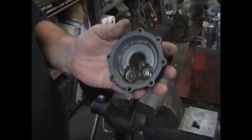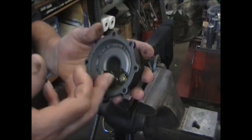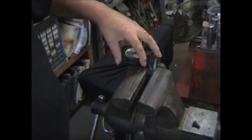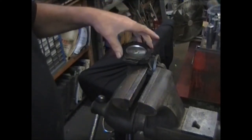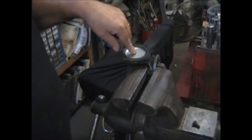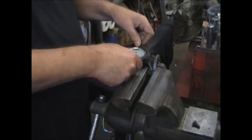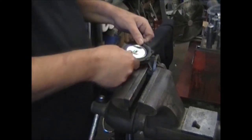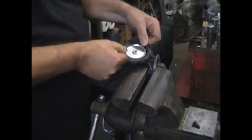Underneath here are your inlet and outlet valves. Remove that screw — this clamp can take out the two valves and the two gaskets underneath them. Now the vacuum diaphragm: this particular one has a square hole in the pull rod. What you have to do is push it up a little bit and try to scoot the bottom out of the link. Sometimes it's easy, sometimes it's not. Go back a little bit, see if you can turn it — if all of a sudden you can, then you've unhooked it.